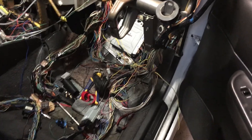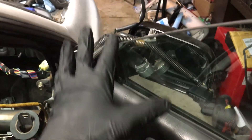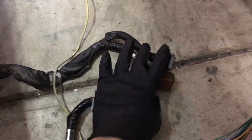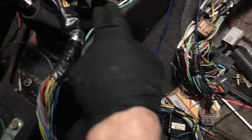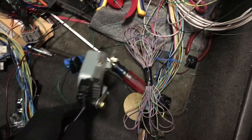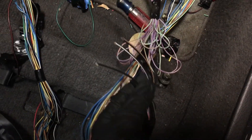This looks like a mess but it's pretty organized. I have all the wiring complete - or most of it - except the fuel pump controller. We have these connections that go to the O2 sensors and MAF sensors, there's this section that goes to the engine harness which plugs in there, and then we have this SMJ connection which plugs in over here. The reason I left it here instead of plugged in down there is because there are some leads - I think it goes to the water temp and something else - and the line's pretty short so it wraps all the way here.